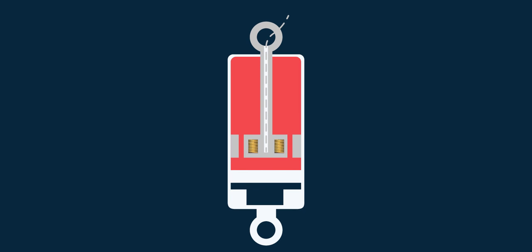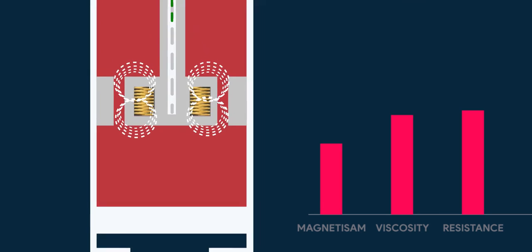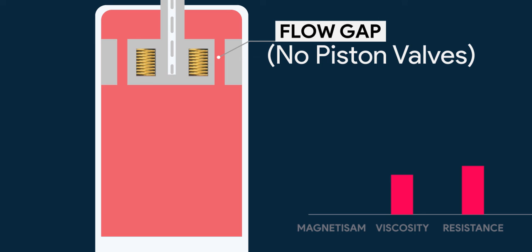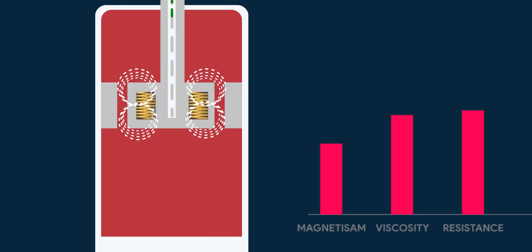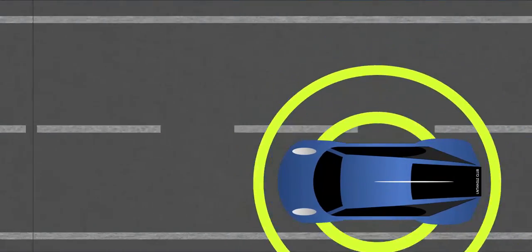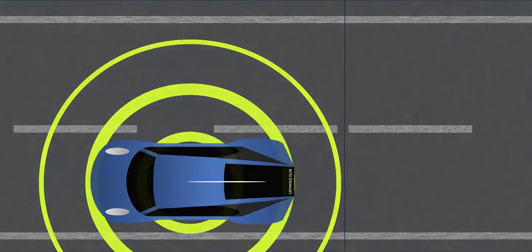The assembly of a magnetorheological suspension is pretty similar to a monotube shock absorber with a modified piston. The piston has electromagnetic coils which, when activated, change the rheology — meaning the viscosity of the oil — varying the resistance to piston travel. Technically, there is no need for separate valves for compression and rebound. At compression, the magnetism can be deactivated or lowered to ease the flow. At rebound, the oil can be magnetized to increase the viscosity, hence increasing the resistance. Generally, the cars using magnetorheological suspension also have radars in the front of the car, so it maps the road in front of you and automatically adjusts the suspension to get the best out of it.